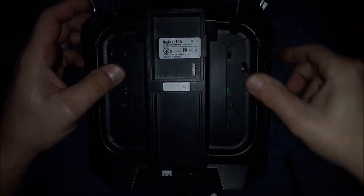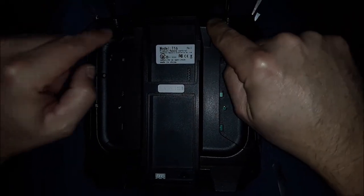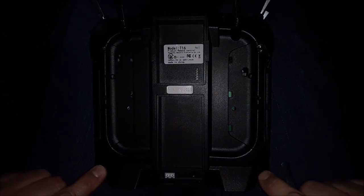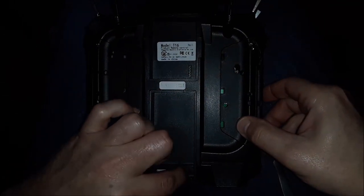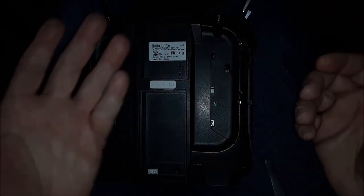Put this piece back in — the rubber part goes over these connectors. Then put the two Allen screws back in, then those Phillips screws. Pop the SD card down, put the module back in, put the battery in, and flip it over.